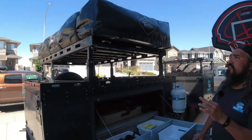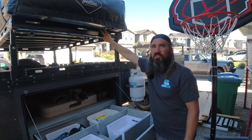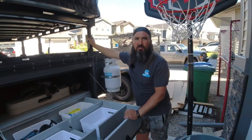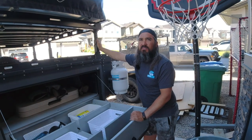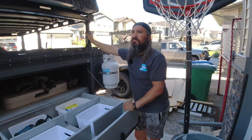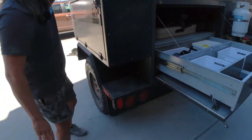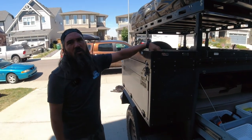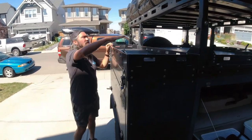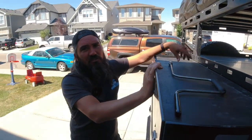Especially when you're looking at three-inch by about an inch-and-a-half angle aluminum that gives it the rigidity and strength, and each one of these uprights is rated for about 1,500 pounds. So no problems getting your whole family up there. There are six uprights once you go with the front box. These flat surfaces have aluminum that is powder-coated with anti-slip — like a grip tape — so you can step up on these side boxes safely in wet or dry conditions for added traction.